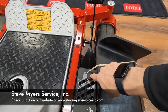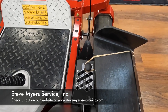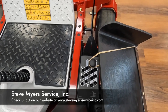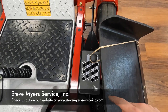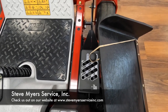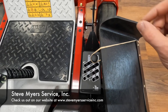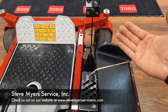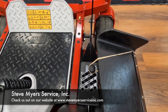That's going to release the pressure off the pin. This is a magnetic pin, so there's no hitch pins or anything that you have to remove. Pull your pin up. We are going to be ranging in height of cuts from one and a half all the way up to four and a half, and they're going to go up by the quarter inch increment. Once you pull that pin out, go ahead and pick your different height of cut that you'd like. Drop the pin — it's going to magnetically stay in there, and you're going to release your foot off, and that will apply pressure to the pin to also help it stay in place.